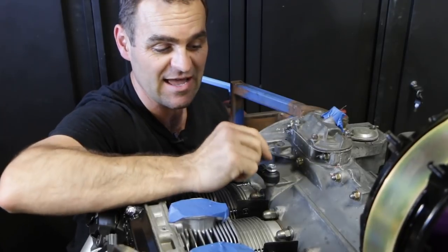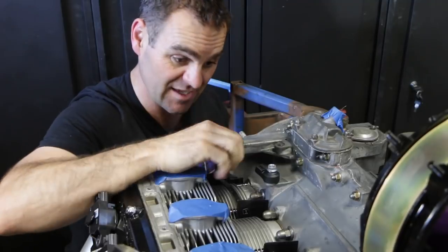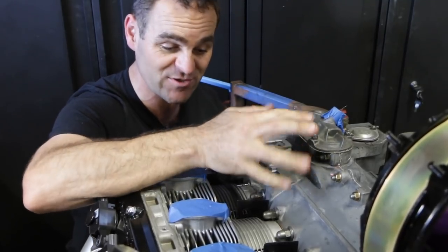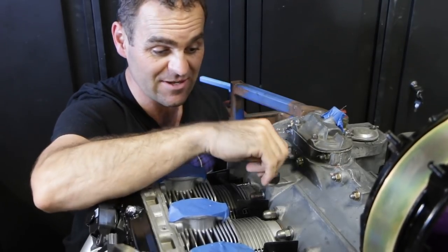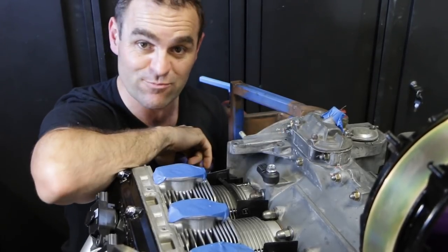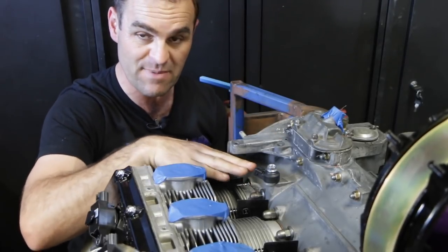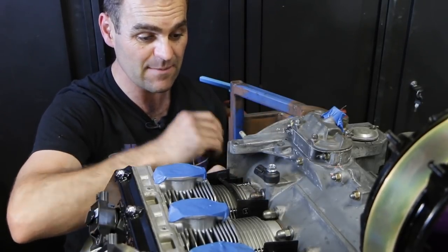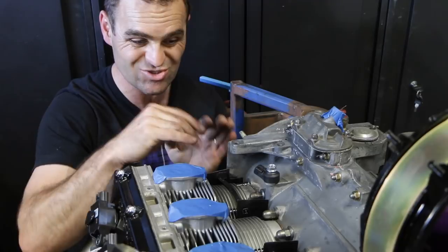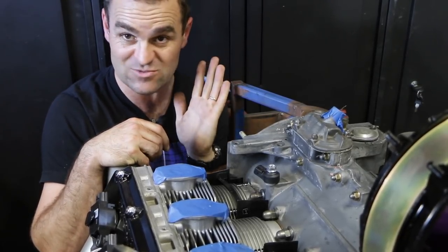After a little bit more research I found that the best place to mount it is actually one of the old throttle mounting plates. Because I'm going individual throttle bodies I'm not going to use the factory throttle anymore, so there's a bolt hole going begging and that's the one I'm going to use. Nice simple problem fixed. I can still access the plug from the back even with the cover on. I'm just going to get some wiring sorted for that — one knock sensor should suffice.